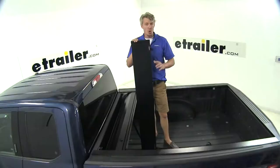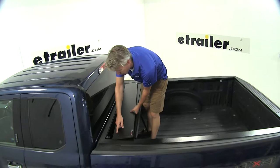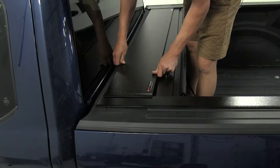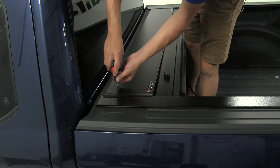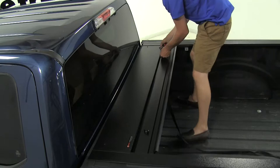With all the clamps in place, it's time to install the top cover. We'll need to be sure that the side with the brushes is facing inside of our truck bed. Let's set it in place. We want to line up the top holes with the brackets on the inside of our canister. We can adjust the nut inside the bracket to make it easier to line up the top cover. We'll do one side at a time, take the black hardware with the Phillips head screw on top, loosely install that, then do the same on the opposite side. With both in place, push the top cover all the way forward as far as it can go, then tighten both of them down.